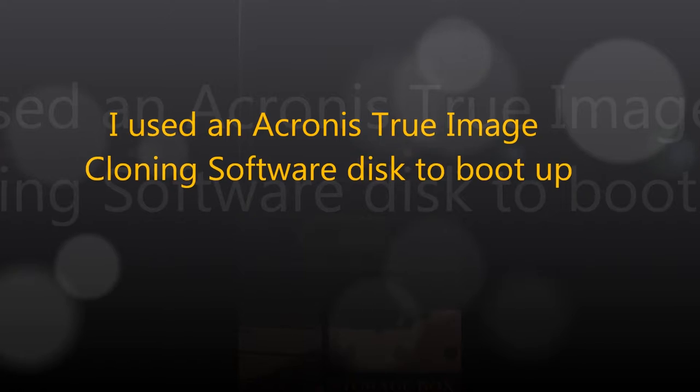Okay, so now we have the hard drive docked up and I don't normally hook it up into the computer. I will turn it on. This has an external power supply and I don't normally turn it on until the Acronis is booted up. The reason why is I don't want it to try and boot onto this hard drive, particularly if your computer's set up to boot from USB. You want to make sure it's set up to boot from the CD drive.